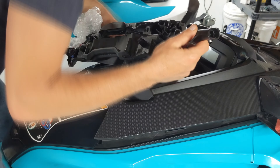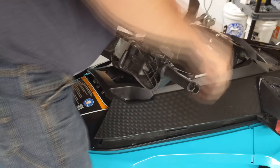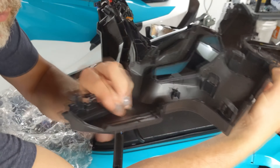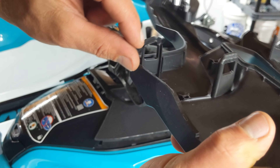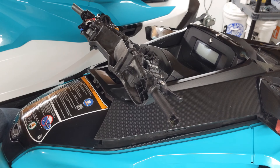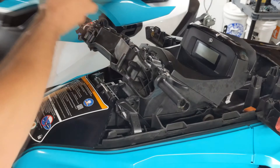This is perhaps the most difficult piece of trim to remove. There are tabs on the bottom and tabs in the front, but the ones down at the very bottom are the most difficult to figure out. Here are the eight tabs that hold on the steering — note the ones at the very bottom. I torqued on one tab a little bit too much; you can see the white stress marks on it, but the other one looks fine. At this point you have enough clearance to take that hatch trim, rotate it sideways, and lift it right off — this was impossible with all that other trim on.